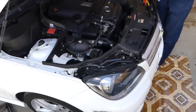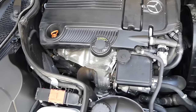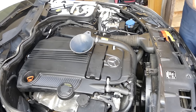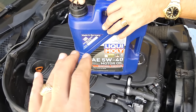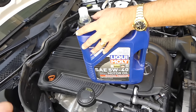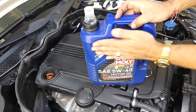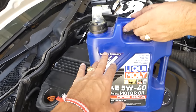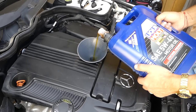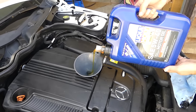According to the manual for the 1.8 turbocharged engine — you can see the turbo right here — it takes 5.8 American quarts, which is close to 5.5 liters. This European jug is 5 liters; in the US they sell 5-quart jugs which is a little bit less. You can find where we got ours in the description below. We'll empty the whole 5-liter jug and add a little bit more after.